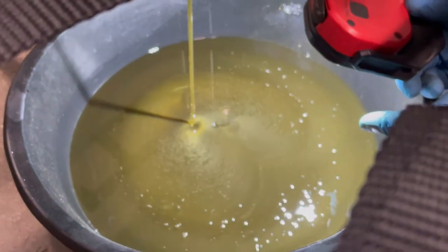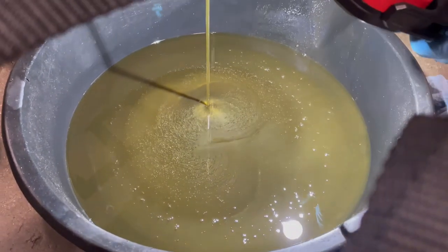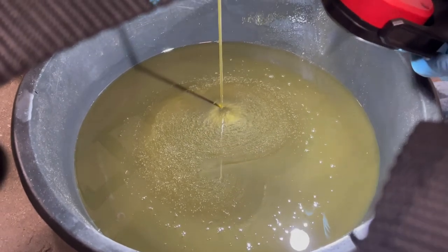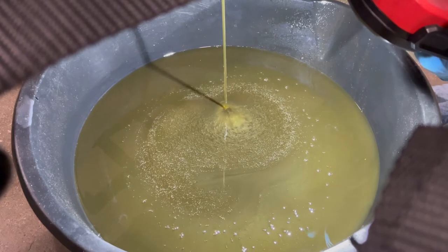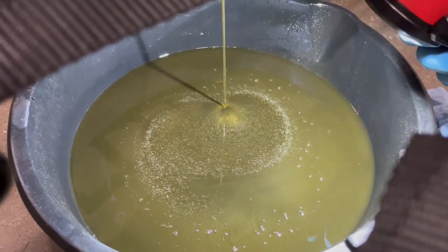I mean, this thing has about maybe 6 passes on the dyno, and you can see that, yeah, there's metal shavings in there. There's metal sparkles in there. It's not, oh my God, there's chunks of metal coming out. It is as thin as the oil, but there's some metal in there because this was a brand new engine, okay?